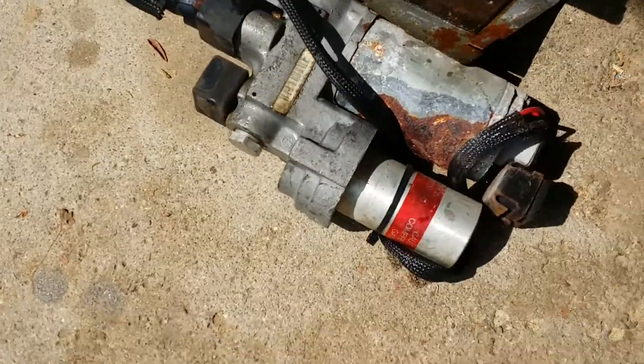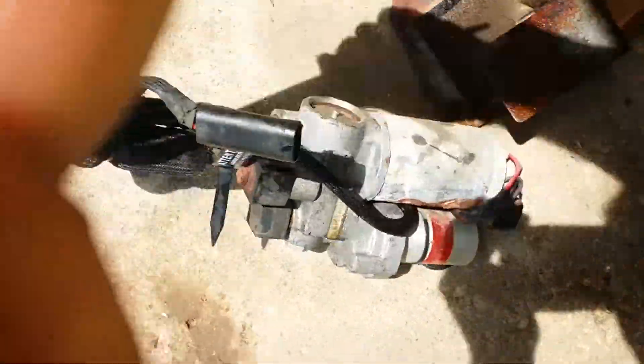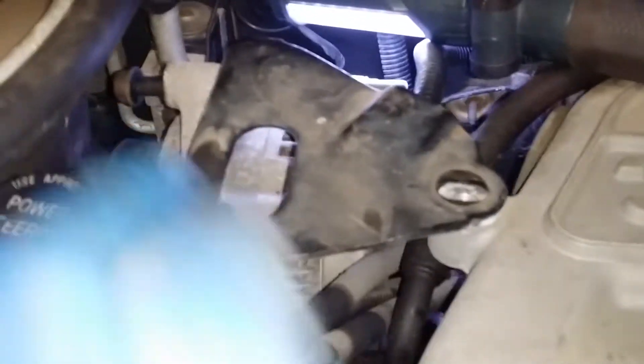In addition to pulling the wiring strip up to get the booster in there, I had to detach the plenum, which involved quite a few bolts. I had to get to this EGR tube — that's the one I forgot. Then there are bolts across the top right here, one behind the coils and then one there to loosen it up. Also there's one on the back that you can't forget about right in that area. It was a little bit harder than I thought to get it in there, but she's in.